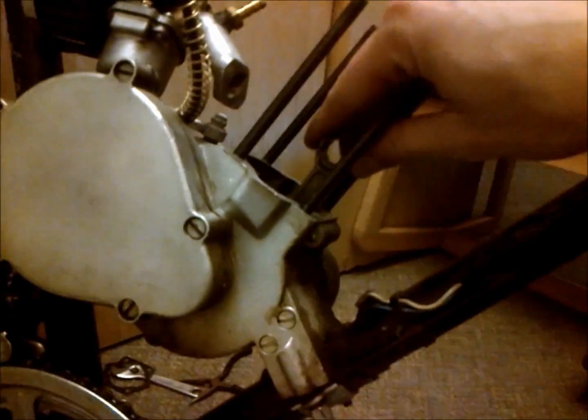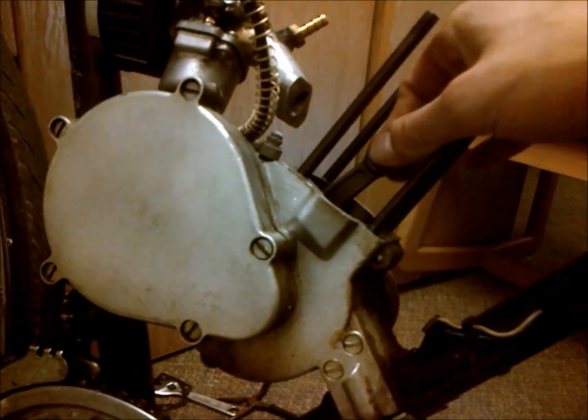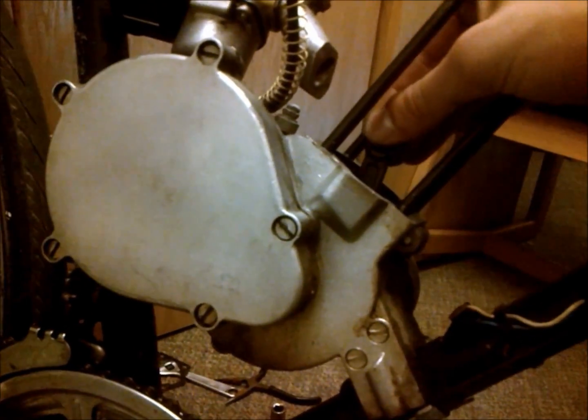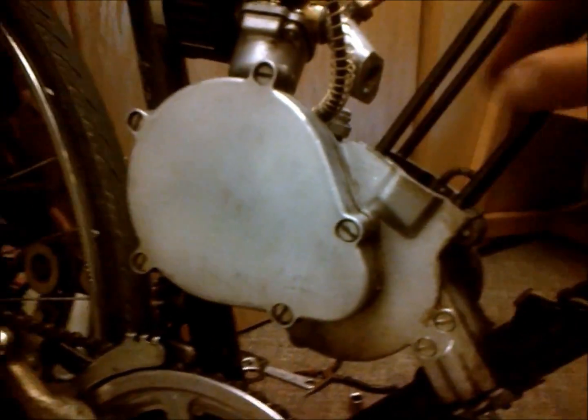The bottom end, I might pull it apart to make sure no particles went in, but rotating around, it doesn't seem like there's anything, but I'll definitely take it off and turn it upside down, shake it around, see if I hear anything inside there. I originally thought it might have been my needle bearing that shelled out, but it's actually in really good shape.